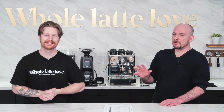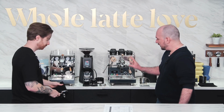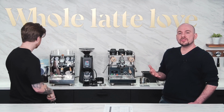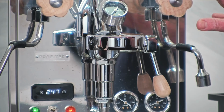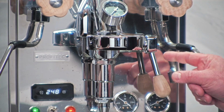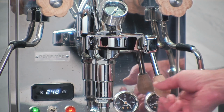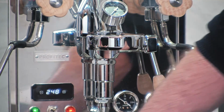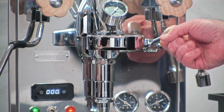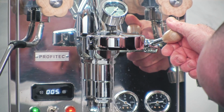So Zach, let's cover a few things. I'll have you start prepping a shot, but then what I want, so this machine's been idling, heating, waiting for us for a while. So Will, I want you to take us to the group actually, because since the heat exchangers are controlling for steam temperature and not necessarily brew temperature, what that means is that occasionally you can get some brew water in that tube that gets just a little too hot, and that causes what's called flash boiling. And you can take care of that. Well, first of all, you can see it. If you lift this lever and the water is cloudy and bubbly, then you want to do a cooling flush.